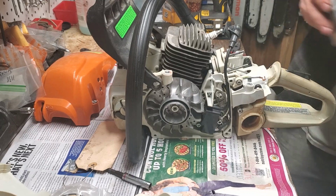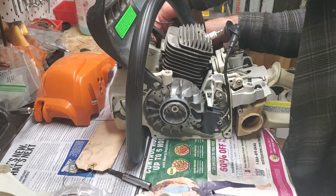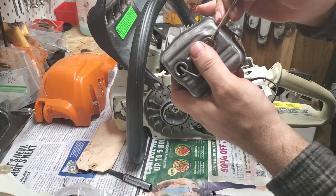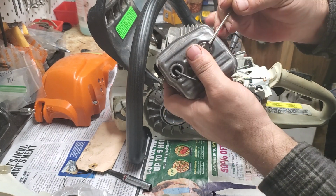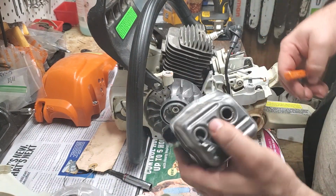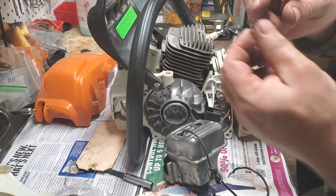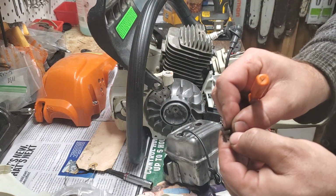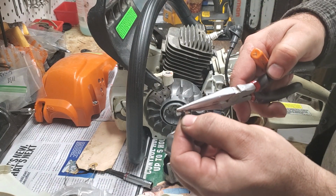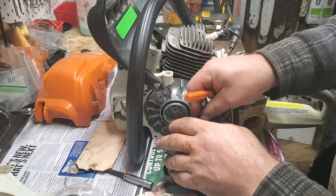But so we will paint the muffler, but this is your muffler, and all it is 2 clips, since you won't get to see it in this video. This one's only got one. I gotta get another one, and I can just pop these off with a screwdriver. And then inside there, you use a long reach T25, and you'll have 2 T25s, one here, one here. And these, if they're a little loose, when you put them back in, all you have to do is bend these prongs out just a little bit. You can use pliers to do it. I personally just take my needle nose and just find where it just snugs and then push them down, and that works great. And if you bend them too far, you can always bend them back.